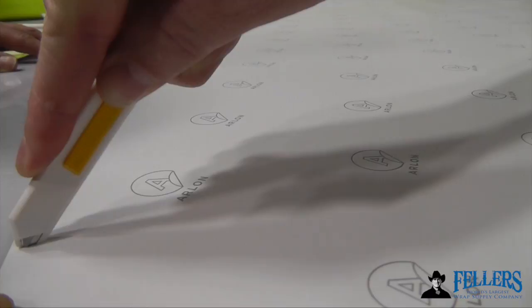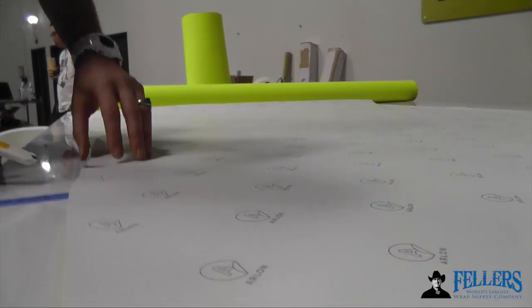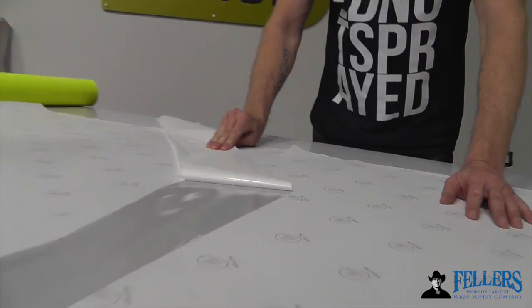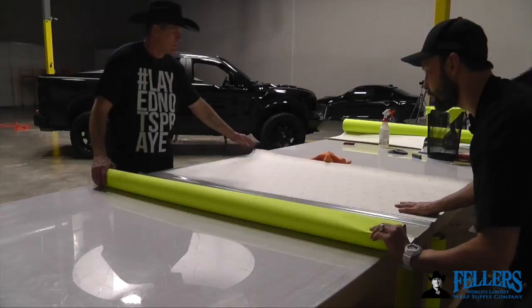Due to the shape of the holder, place it at a 45-degree angle so it's flush on the backing paper. You do want to apply good pressure so it cuts correctly. If you have the right adjustment so it doesn't cut too deep but enough, you can put pressure on. In this case, this is a panel for the composite hood. Cut a width of about 10 or 12 inches, then remove the backing paper — very easy. Once you get the right height, it simply slides off and exposes the back of the adhesive in a nice, clean, straight line. This is a perfect way to set up a permanent hinge and work the hood properly.